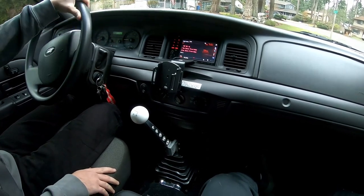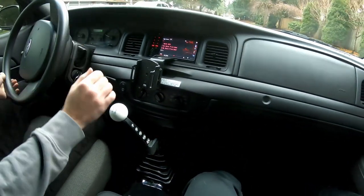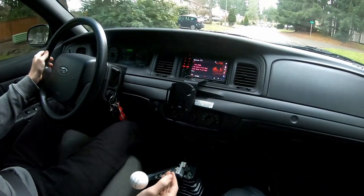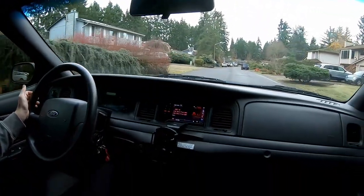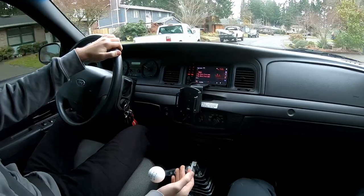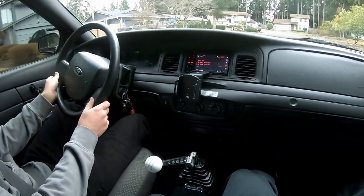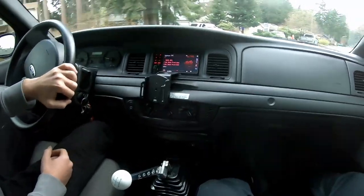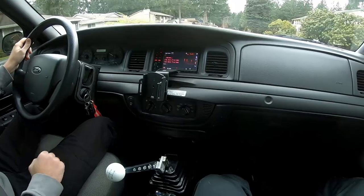I really think you're going to find that you're going to be able to drive the car even smoother because you don't have all that wasted space. And when I get in it and drive it, it's going to be normal to me, but you're used to the old way so now it feels funny. The pedal hits the floor the way that it was engineered to — whereas we're trying to make Mustang parts work in a Crown Vic with a custom pedal. The clutch is adjusted properly; the reason the travel was funny is because of the way we built the pedal.